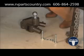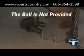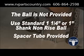Next, install the ball to the hitch head assembly. The ball is not provided; install the appropriate ball to match the coupler. Use a standard 1-1/4 inch or 1 inch shank non-rise ball. If using a 1 inch ball shank, use the spacer tube provided.